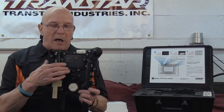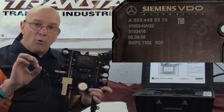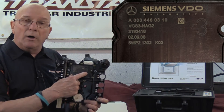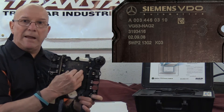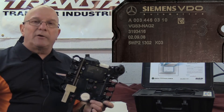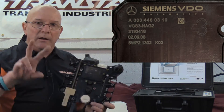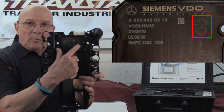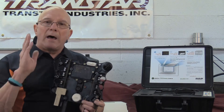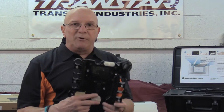One important thing about these units: right here is a number — it'll be no stamp, one, two, three, or four. Four is the newest one; number one or no stamp is the very early one. The only way you can get that early one fixed is to go to the dealer and buy a valve body and everything, because it's a match set. If you have a two or a three, this unit will work — two and three will flip-flop with each other. However, four will not. Berkeley's working on that, and hopefully soon we'll have number four supported so we can keep you going and up to date.